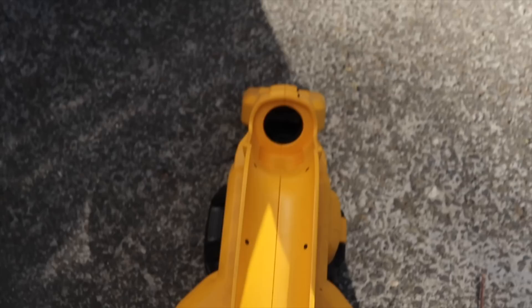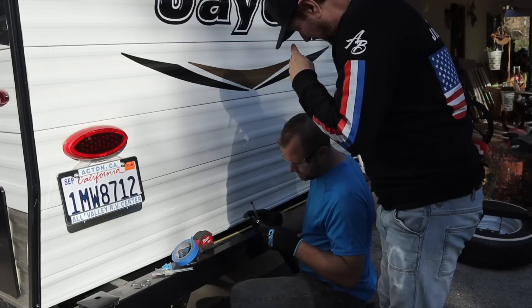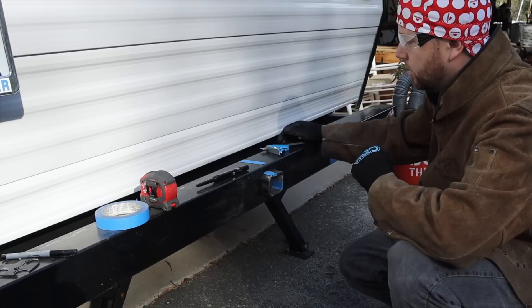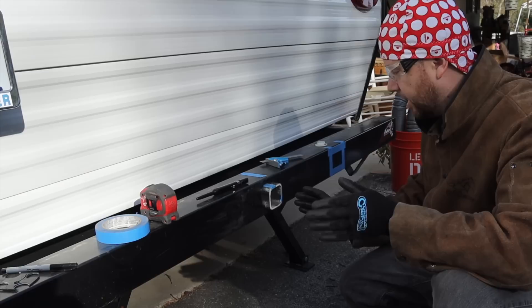We did our job right. I just brought out my little vacuum. Quick recap before the lunch break: we did a lot of measuring, cut out with a step drill four holes in a quadrant, then jigsawed into the radius of those step drill holes. We were very excited because the tube fit in there just nicely — a little bit of gap, but we're not doing this with a CNC, sorry. Next solution: we need to drill the same hole in the back. Turns out there's less than six inches of gap between the poop tube bumper and the actual structural cross member. One jigsaw might fit in there, but it won't be good.